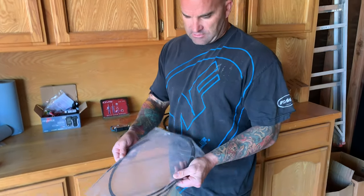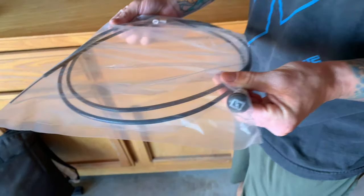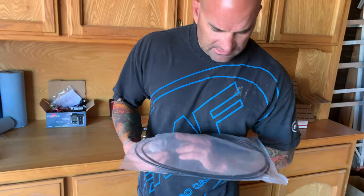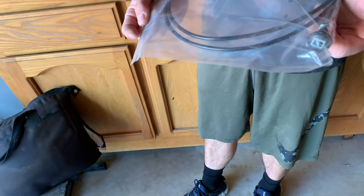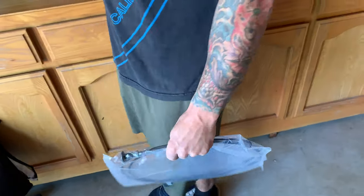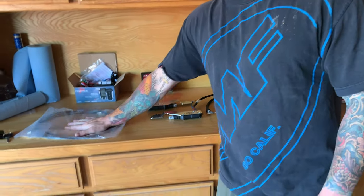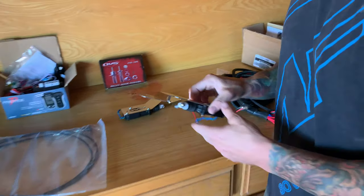And this also, can you see it really well? This is basically just an emergency latch in case your battery dies or something like that. We're not going to put this on there, but basically you can see right here, this hooks up to one of the doors, and then you hide this somewhere on the truck. So when you pull it, this will pull your latch, and then your actual door pusher right here will open your door for you. This is for emergency situations, and we'll get that installed too. That'll be part of the video also, but right now we're gonna do this one right here.